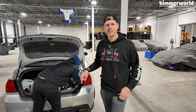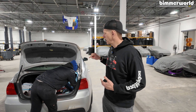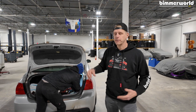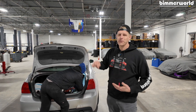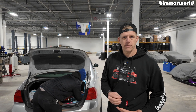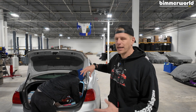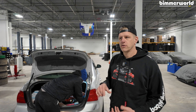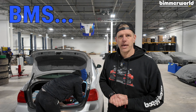We're going to talk about how to install this thing. The mechanical stuff's pretty easy — it's just reverse removal. But there are some additional concerns when you are installing an Optima battery or any battery. Just the basics of registering the battery. So when you install a new battery, the cars that are E90 and newer — and it really started in an E60 maybe — when it hit the three series, four series, we had a BMS.